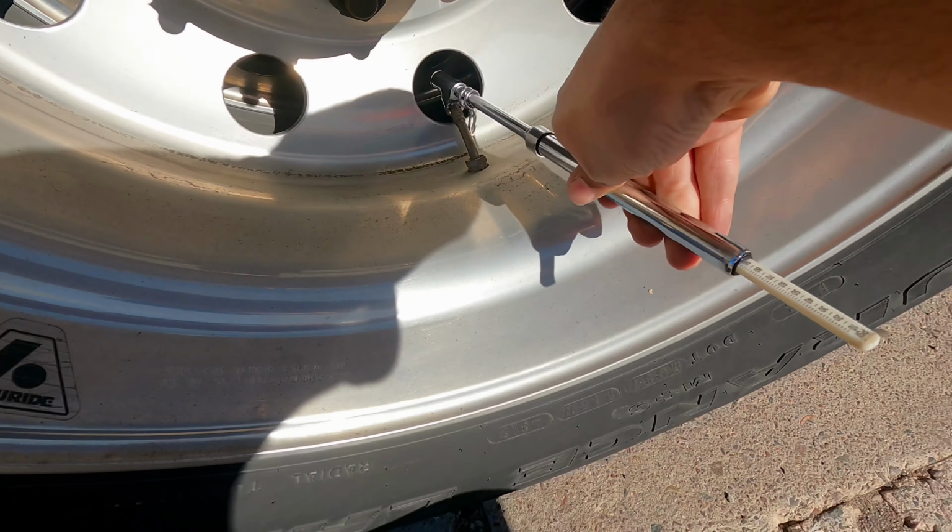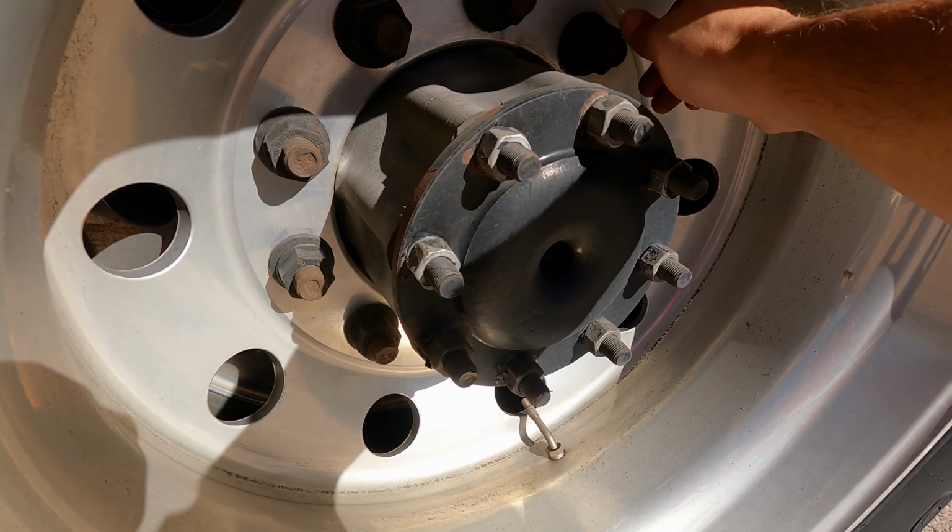Want to make sure it's worn evenly, no cuts or damage to the treads or sidewalls. The valve stem and caps are not missing, broken, or damaged. The depth is no less than 2/32 tread depth on the drive tires. The rims are not damaged or bent, no welds, no rust, or any powder trails indicating loose lug nuts. You want to check that the lug nuts are not missing, loose, cracked, or distorted.